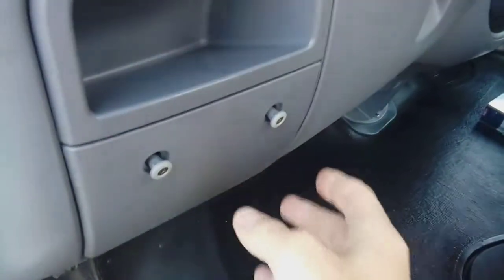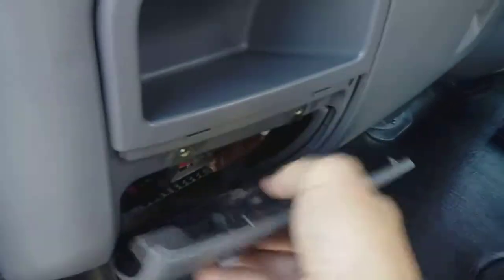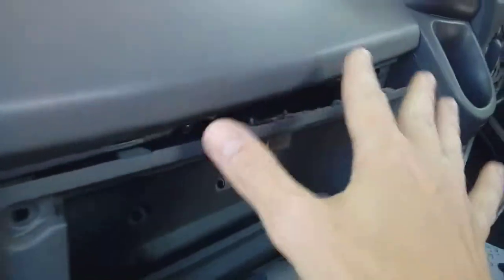I'm sorry about the background noise here — unfortunately I don't get to choose the location of where I'm doing these videos. Pop that out — there's access to your fuse box, should you need it. Next up we're going to pop out this pocket here. To pop the pocket, normally grab the edge clip and out it comes. So you're getting nice access now to run all your cabling through so you can easily get everything to where you want it to go. We're going to open the glove box, get the two TX25s out from above here. We've also removed these two, but we're going to need a socket because it's quite hard to get to — they're just tucked up near the latch. Take both those out. With both those out, everything will start to come loose.